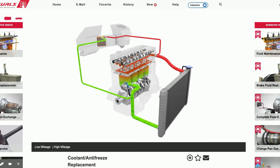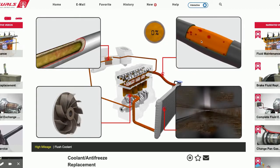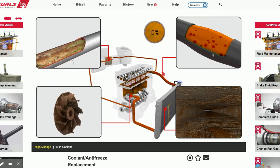Most of the heat is generated in the cylinder head where you find the valves, spark plugs, and sometimes injectors. You can see a square design — this shows what happens when you overheat your motor: you blow the head gasket, it cracks or gets blown out, and you end up with white smoke from the tailpipe. One reason for changing your fluid is to prevent the corrosion that compromises that gasket. At high mileage, particulates increase, hoses become crunchy and hardened, or soft and swollen — especially if oil leaks onto them.